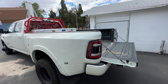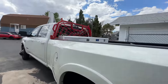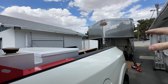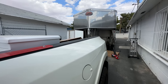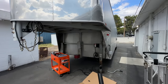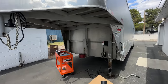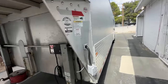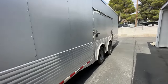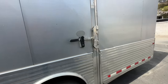Backing up and turning around is completely different. I mean, you can jackknife this thing - I did a U-turn in this thing and I damn near hit something. You can turn and you are like in the shape of a V. On a tour bus, your tag axle on your rear can be lifted so that when you're making super tight turns you're not scraping the tires, because you'll wear out the inside of your tire doing those kind of turns.